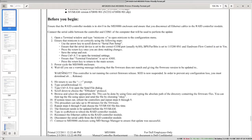So for now, we are in the firmware download mode. We have to press 3 spaces. Then we are gonna see a prompt to tell us to send the file through the XMODEM protocol. The XMODEM protocol is a protocol to send binary data through the serial port, which is supported by Minicom. XMODEM also requires the LRZSZ package to be able to use the XMODEM protocol. Otherwise, you are gonna see no errors, but it's not gonna start the transfer.